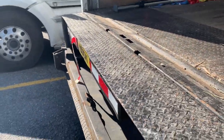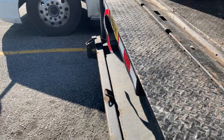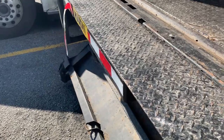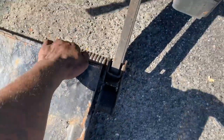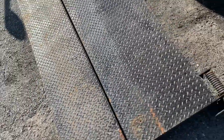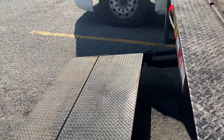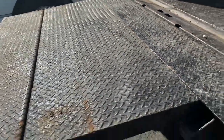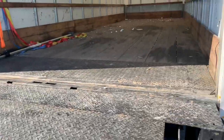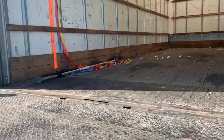This lift gate — the switch up here brings it up and down. Do not purchase a truck with a small little gate like this. If you like the truck and you think you're getting a good deal, make sure you take this little gate off before you try to operate. This small lift gate — you cannot do anything with it. You can't get most of your loads on here, so you'll just be wasting your time, or worse, damaging a shipper's product. Don't get this lift gate.